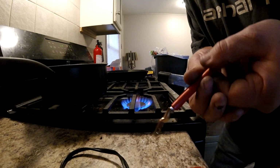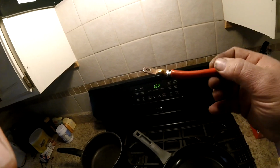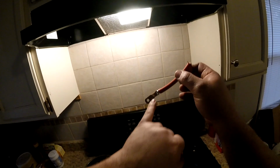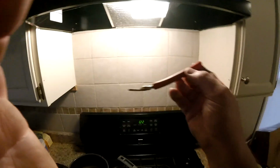See, I got enough solder all around there. There's no chance of that pulling out. Let's get you up by the light. That dimple right there that I made with the chisel is a certain thickness. We've put enough solder in there. We filled that hole. That solder ran down into the fat part down here. And by having solder down in the fat part, it's so thick, it's impossible now for it to pull out. There's no way that fat part can pull through that little part. And this joint is really solid.